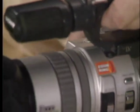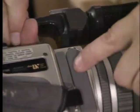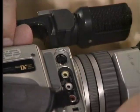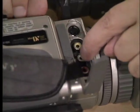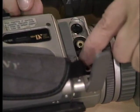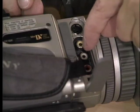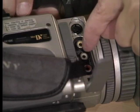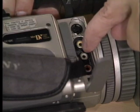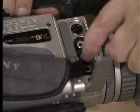On the other side of the camera, if you open up this little rubber attachment, this is your patch bay. We have three RCA attachment jacks, so you can send video and audio out of those, or take video and audio in and put a signal through the camera. For example, if I attach an RCA cord to my video yellow jack here, I can go out to a monitor so you can see what I'm shooting. The same applies for audio.